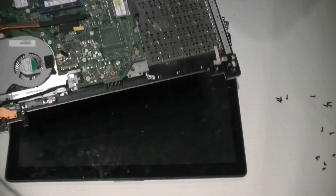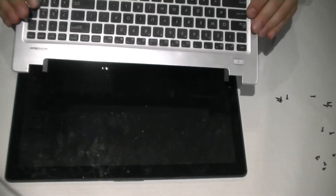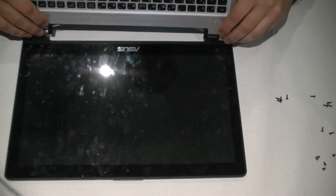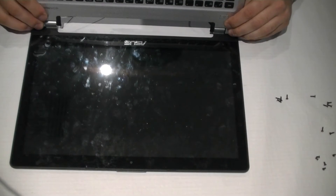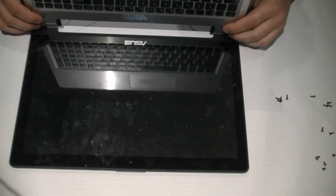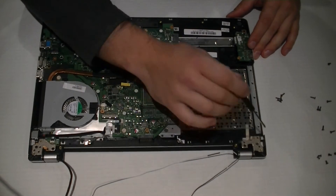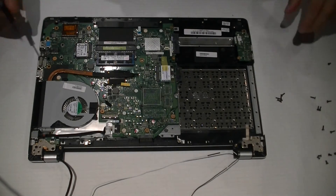The actual motherboard and keypad — the bulk of the computer — make sure you have this the right way around. You're going to put it on like this onto the screen, not the other way, or else you'll be running around in circles. Put a couple of screws in to hold it in place and you can fold it shut and keep working on it. For the screen, you only want to put in the screws with the little arrows pointing to them. If you screw in the other screws, that's part of the casing that binds it all together.